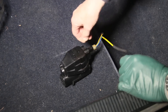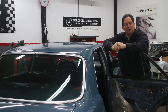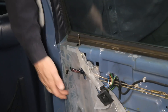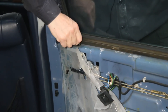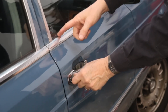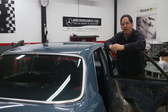At this point I'm not going to go any further until I find out whether this pump is really operating properly — it's running, but that doesn't necessarily mean it's okay. With these cars it could be a number of things: a wiring issue, a pump issue, a vacuum actuator door lock issue, or a switch issue on the door. You need to understand how the whole system works to adequately troubleshoot it.